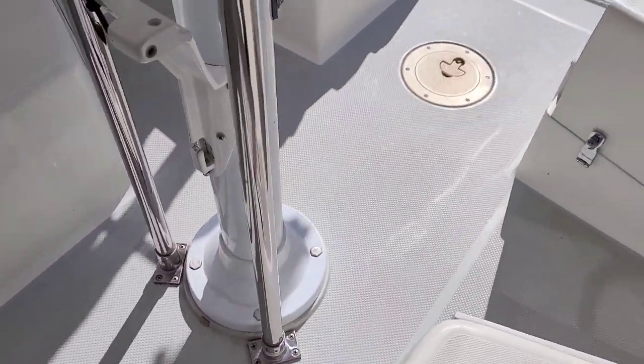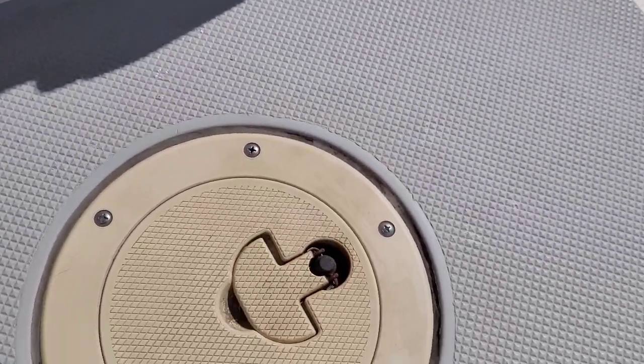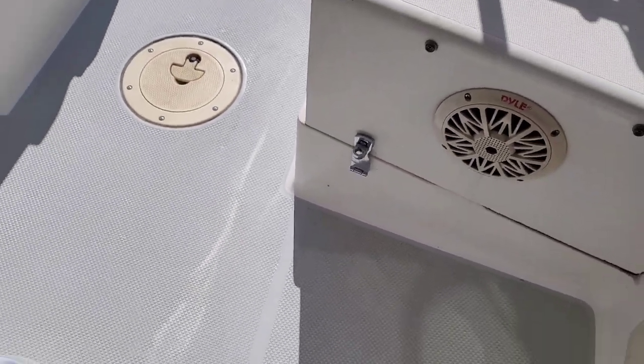I prepared my solution — I don't need much — and I'm using the brush to get gel coat into the pinholes and cover as much as I can. I didn't tint it, so it'll be darker than the original color here, but that means I'll be able to see where my repairs were and whether I need to touch them up again before I do a top coat. Now I've finished touching up all the little pinholes and you can hardly tell. It's still a little bit tacky so I'm going to give it about another hour, then clean it up with acetone, and then lightly scour it with sandpaper to create adhesion before mixing my top coat.